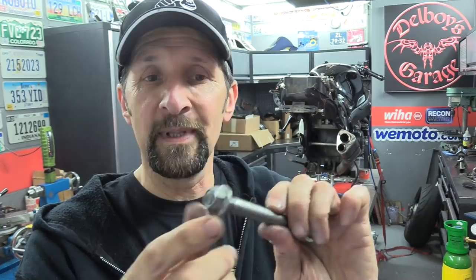Now, they are lock nuts. So all I'll do with these is put some nice anti-seize on them when I reassemble all that and do them up. And that will mean that when I undo them in the future, should that day come, it won't come undone like a barn door creaking like they did before. So there we are, that's it.